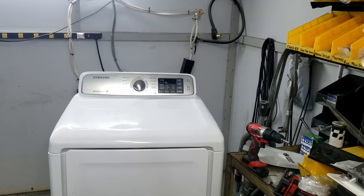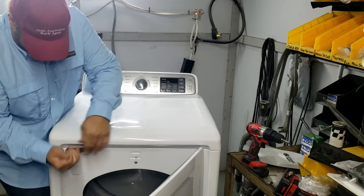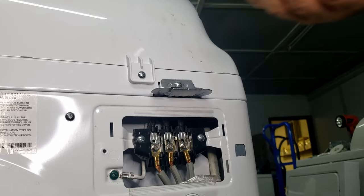To remove the top of the dryer, you can use a putty knife to depress two tabs on the dryer to open the lid. However, the clips on this style dryer may be too stiff to allow you to open them — in this video I failed at it, so I decided to open the top the alternate way from the back. On the back of the dryer, two screws hold the top of the unit on. Unscrew them and you'll be able to push the lid forward to lift it upwards.